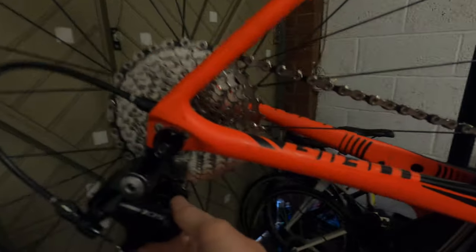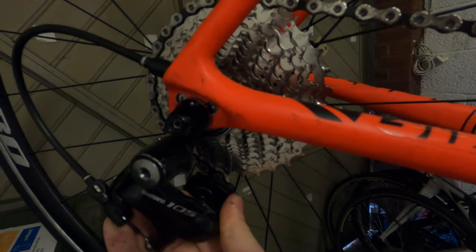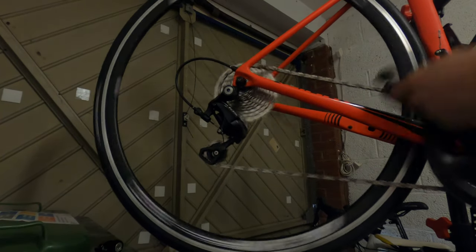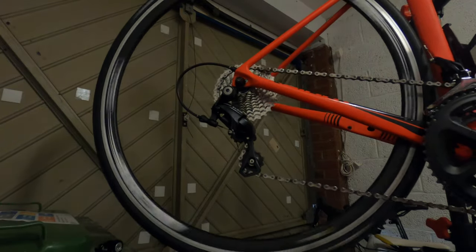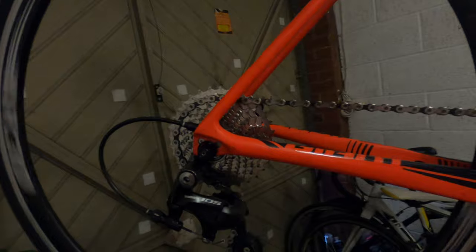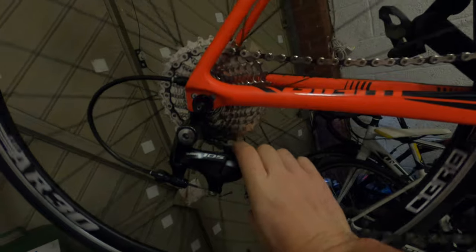So I can't get that any further away. I did think that if I pull the chain a little bit tighter it would pull it away a little bit, and that would be just about okay. But a lot of the time I'm riding in the big ring at the front and the chain will be fairly straight - that's where the derailleur is getting pulled to. I could maybe take another couple of links out of the chain, but I'm not sure it would really help.